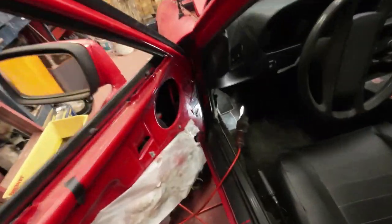Yeah, I'm underneath the dash here, right? So what did I do with the... that's the fuel pump relay, okay? So this one here is number 30, right? Yeah, 30 here, 87 here. So one of these is hot. I think this one here goes to the fuel pump. This one here comes from the battery, or the other way around. Anyway, that doesn't matter, but you've got to get it.